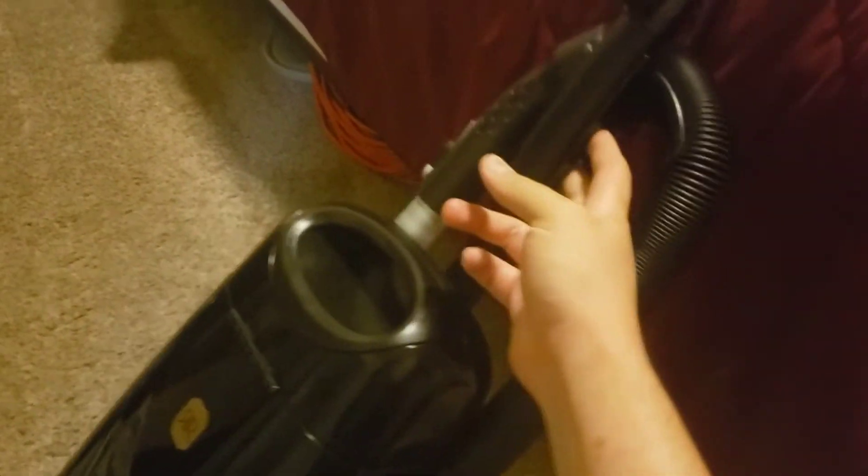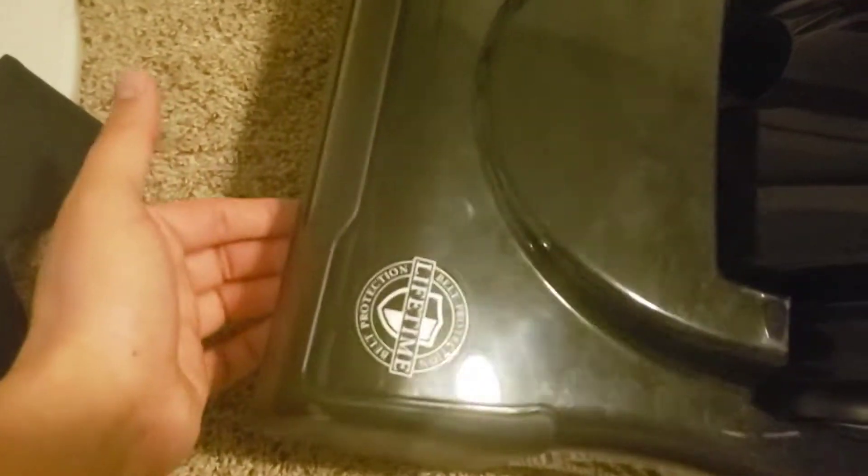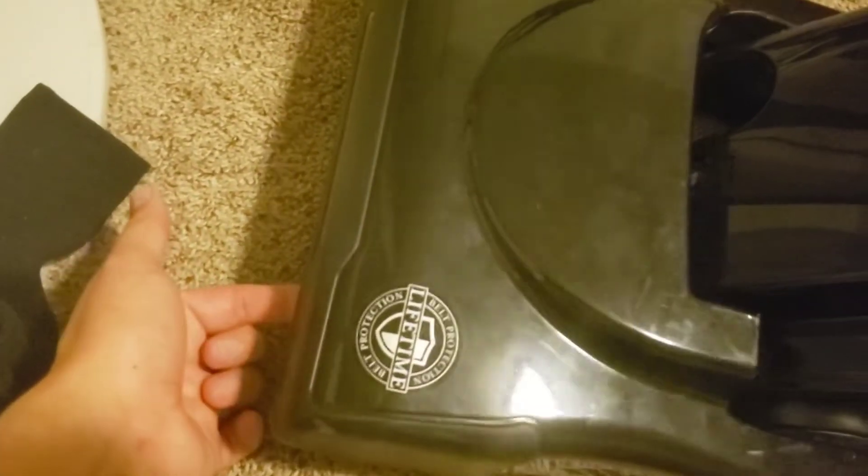If I'm down here at the nozzle and I push on it just slightly, I get better agitation out of it, or at least visible agitation. I think the problem is they just don't have enough weight on the front of the nozzle, because this machine, similar to the Tandem Air, does use a spring. The purpose of this spring is to take some of the weight off the handle, making it a little bit lighter in hand. But the problem is it also takes a lot of the weight off the nozzle too, so it doesn't really have much downward force, and it takes very little to remove it from the carpeting.